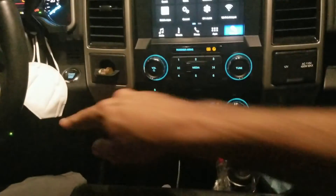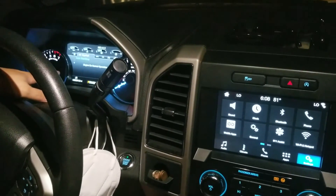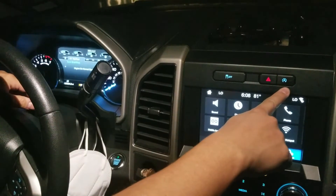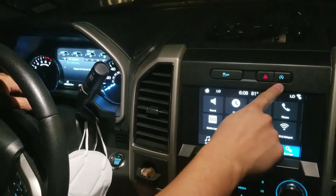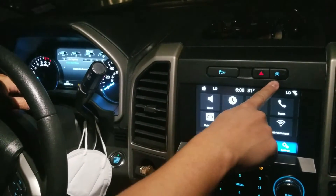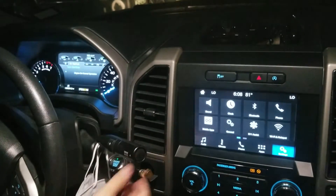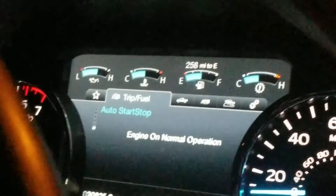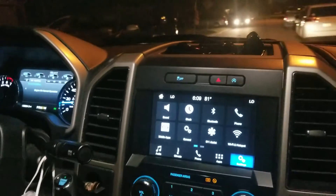Let's go test it out. Unplug it and let's go. That indicator over here is showing auto start-stop in normal operation. I've already turned the truck on. The button still shows as if it was enabled, but we didn't mess with the button feature — all we did was disable it in the module. The truck is on and we're driving away to see what it does — and that's normal vehicle operation.